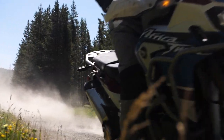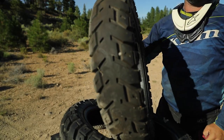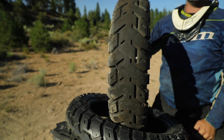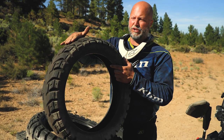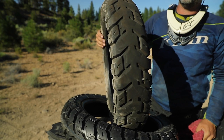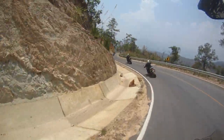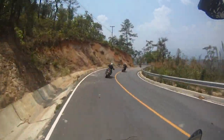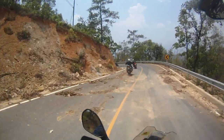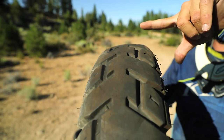While this is a great tire, it does have a few downsides. One of those is that it gets a flat tread pattern after use — see how it levels off perhaps a little quicker than some others do, especially in relation to the deep lugs on the sides. Depending on how much you're leaning and turning while riding — whether you're riding those chicken strips or not — it is going to flatten out in the middle perhaps a little more than some other tires.